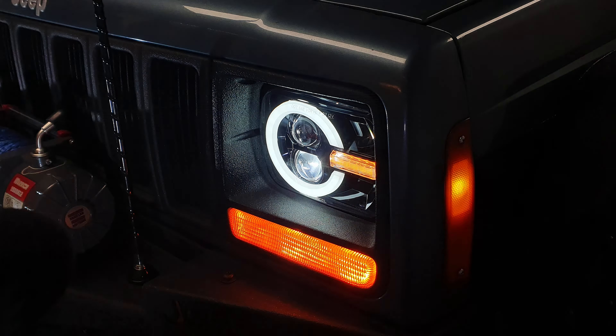One thing I picked up just to go with these auxiliary lights is a plug-and-play relay kit to support auxiliary lighting. These make it super easy and they also have a wire on them so you can hook that up to your main beam. So when you flip the main beams on, I'm going to try and have these come on as well, so everything comes on together — nice and clean rather than fiddling around with a switch on the dash. So let's get installing.